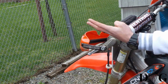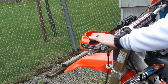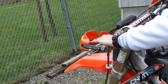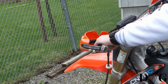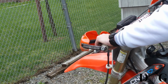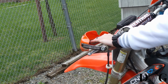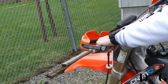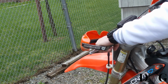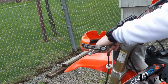There is one more method that I like to refer to as the beginner method. You will have guys that are new to riding, might not have the endurance built up in their arms and their hands yet. What they will do is they will use all 4 fingers to pull the clutch in. Like I said, they might not have that strength. Do not get in the habit of that. Try to avoid that. Try to stick with 2 fingers if you don't have the strength with 1 yet. Get the fundamentals down. You can dab that clutch with a single finger or 2 fingers, whatever you prefer. It is rider preference.